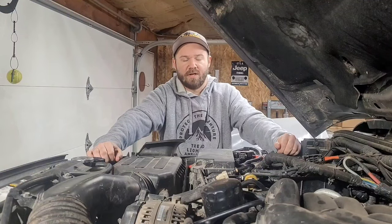All right, so it's been about a week since I installed the oil filter adapter. I put maybe 50 or so miles on it. Not a whole lot of driving, but a lot of starting and stopping because we went on a couple day wheeling trip. So a couple things I did notice. There were some times when I had dry start still, especially in the morning. So it didn't eliminate it completely. It might have made it a little bit better where it did get oil a little bit quicker, but I definitely got dry start and got the real aggressive clattering.